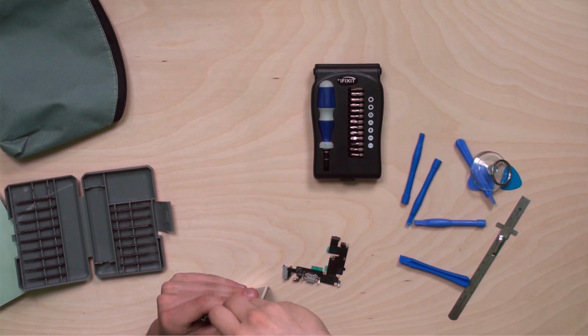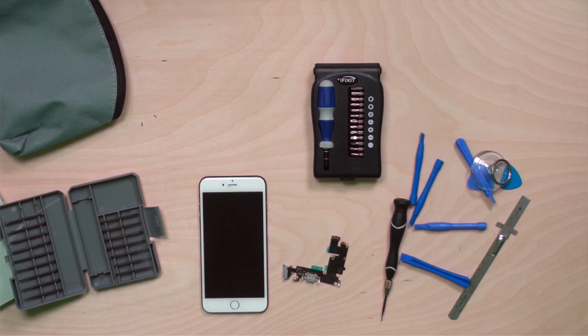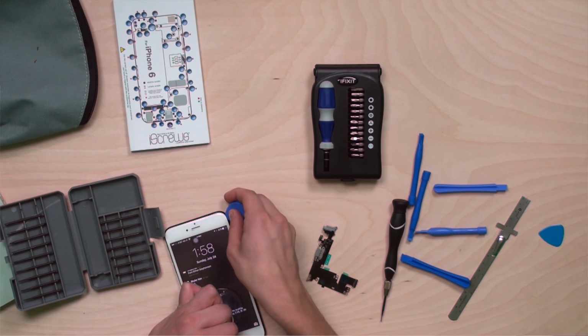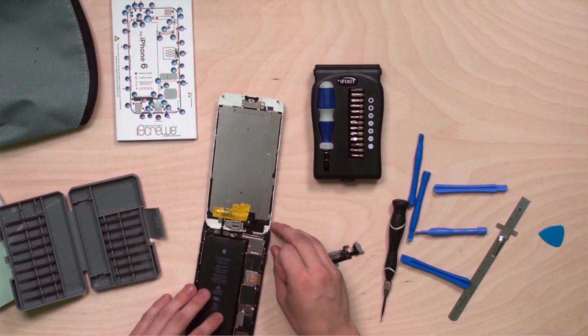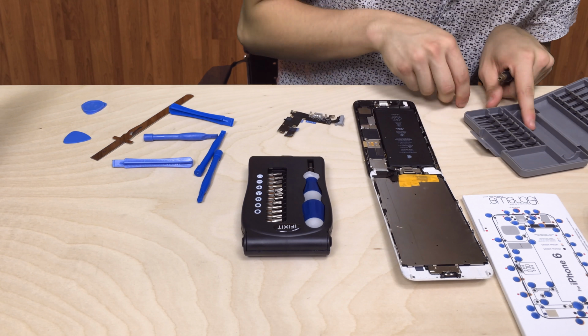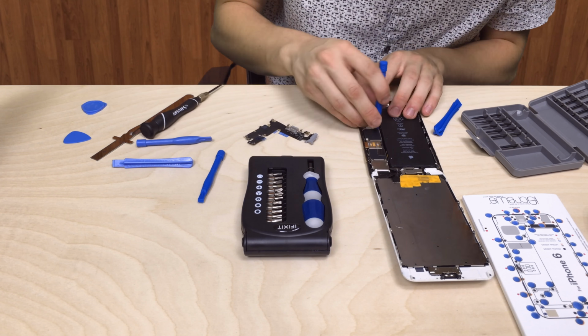Before we start this procedure, make sure you turn off your phone just so you're not shorting out any connectors. We're going to be disconnecting the battery and we don't want to ruin it in any way. If you accidentally do ruin your battery, a link will be in the description below just in case you want to buy a new one. So guys, we're going to start off by taking the pentalobe screws out just so we can take off the screen. From there, we're going to begin to take out the screws that connect the battery.